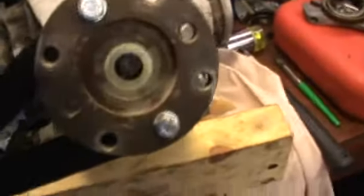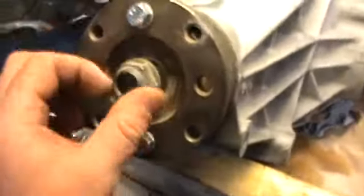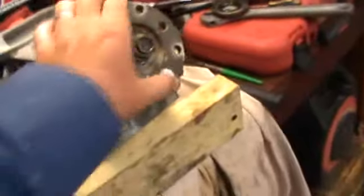That goes on there. There you go. On there is a nut. It's standard clockwise turning, nothing special. But you need to hold it. What I've done, this is the bar for holding it. It's a camshaft tool. I've bolted it through on the back side, then I can get a spanner on it.